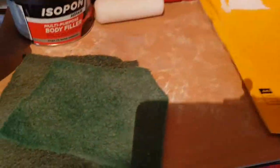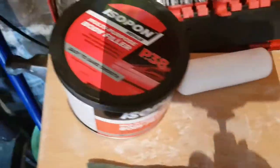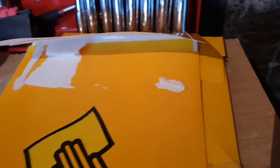Here's all the stuff I used. I've got some body filler, just from Halfords — just any old body filler, this stuff worked quite well. And I got my sandpaper, a few different ones. What I did is sanded down with 60 grit to put the body filler on. Done that until you're happy, then used 60 grit to make sure the filler was as flat as I could get it. Then used 400 grit — I've actually used up all my 400 grit to get it a little bit smoother.